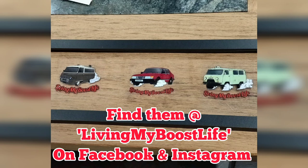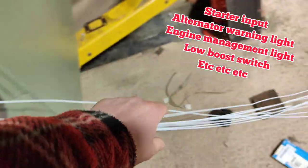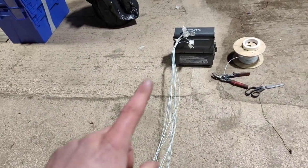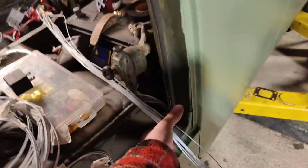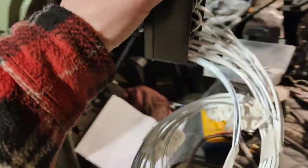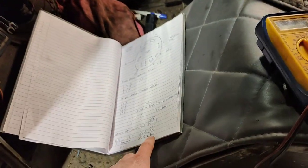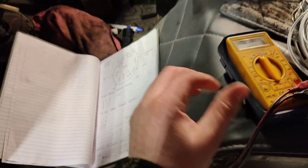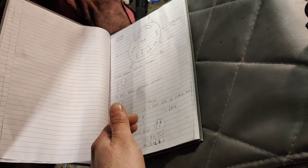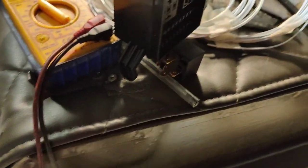Or consider buying some of those awesome stickers I've had made. I've extended these wires with a variety of 18 and 16 gauge wire, doing the trusty tie-to-something-on-the-floor method. This wiring is going to run around the side of the bay, underneath the radiator, then back through a grommet into the back of the dash. The relay and fuse box is going to be mounted up under here. I've had to continuity-check the back of the hazard switch because I can't find a wiring diagram for it - I don't speak Russian. I've worked out what I'm going to do with the hazard switch, continuity checking with my multimeter that doesn't even beep when you check for continuity.